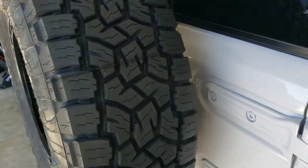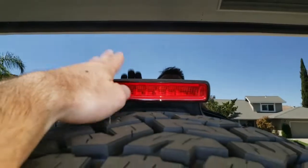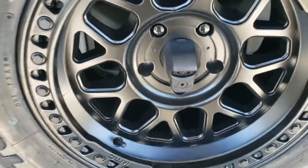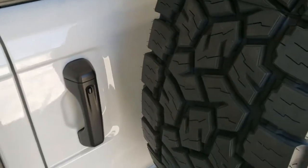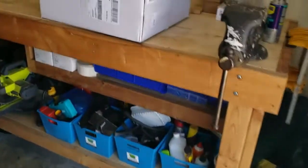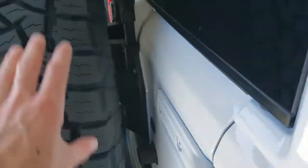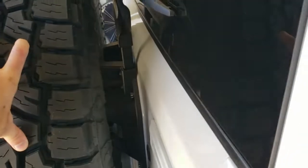What we're going to do is suck the tire back in 54 millimeters and raise it by installing the TeraFlex adjustable spare tire mounting kit. This will replace the factory bracket with the TeraFlex one and relocate the third brake light to the center. If you have a four-by-e like we do, there's also a speaker that plays a whirring electric motor noise in reverse. I have a bracket on order from TeraFlex to hold the speaker, but for now I'll install everything without it and keep the speaker unplugged so the wife can back up without the beeping.